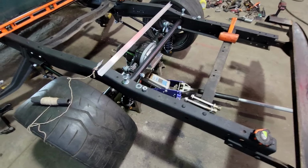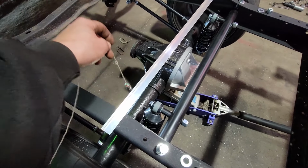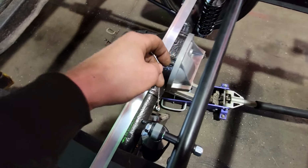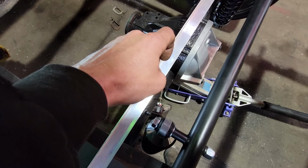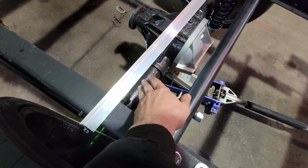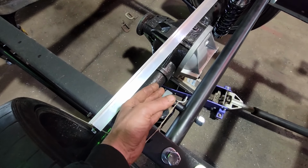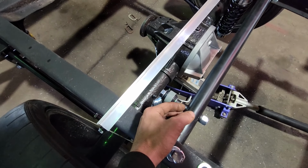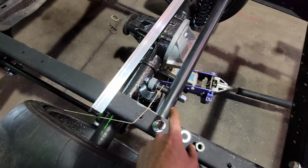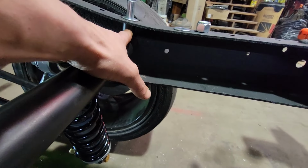There be light. Oh, as you've seen, I clamped this bar down here to the frame. Instead of trying to plumb down onto the center of the axle tube, it's kind of hard to determine exactly where the middle is, so we plumb down to the edge of the tube and let that string just kiss the side of the axle tube. And what we need here is 5 inches from the end of this tube to axle center line, so we just took the half of the axle diameter and subtracted that from our measurement. It's a 3 1/4 inch axle tube, so 1 5/8. We needed 3 3/8 from here to here. So we got that bar in there after a bunch of grinding and beating and more grinding, but I ended up having to take about 1/8 inch off this total.